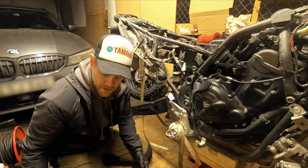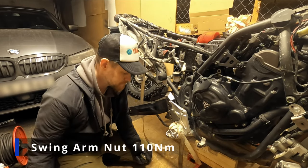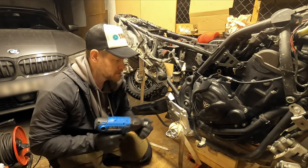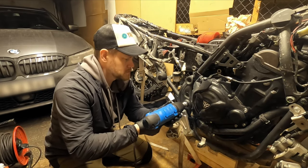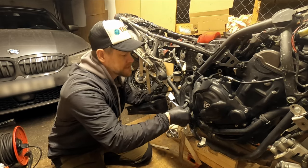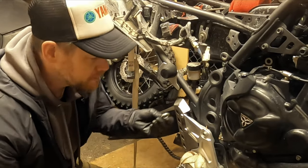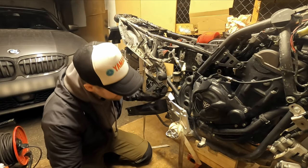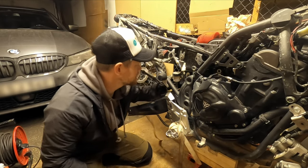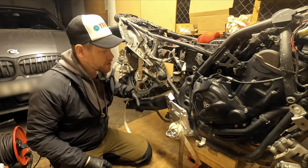It's not a lot — it's more on this nut here. I will use my impact driver to loosen it up as I have my bike on the stand. The nut is off. If I push this axle out, you also have a pretty fat washer here for the nut. Put that aside and push the axle out — grab it on the other side. It's a long axle.